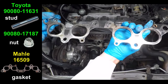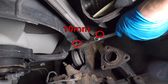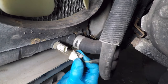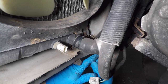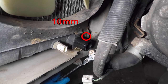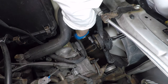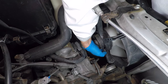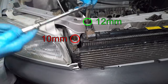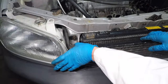The upper gasket is made of two sheets of metal and it's still in good condition. The fan shroud bolts take a 10mm wrench. That bolt snapped off — and this one too. I'll unplug the radiator temperature switch on the right side of the car, then take off the lower radiator hose. Then I break off this rusty fan shroud bolt, then break the fourth and final bolt on the bottom of the radiator. Unplug the fans. They're still not ready to come out. I didn't care about the fan shroud bolts snapping off, but these bolts thread into the unibody. The radiator support takes a 12mm wrench and the condenser takes a 10mm.